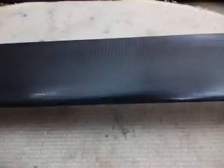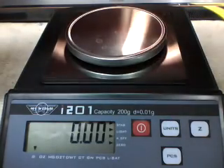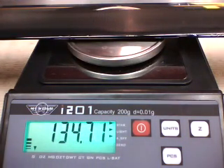One of the things we've done to the blade now that it's out of the paint booth — after the clear coat application on the leading edge — is I've gone back over the entire blade surface and lightly sanded it wet with 600-grit wet dry paper. That's just to prep the surface for putting the tape on, gluing the components to it, and then it's going to get a final clear coat at the very end. Once again I'm just going to check weight after the clear coat has been added and after some light sanding for surface prep.